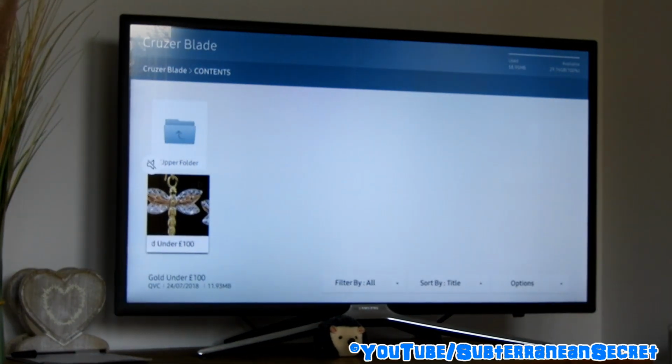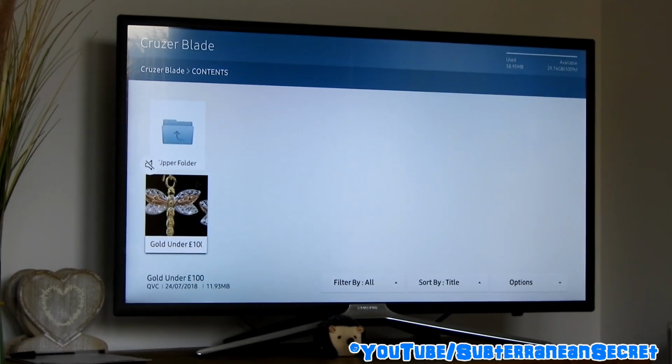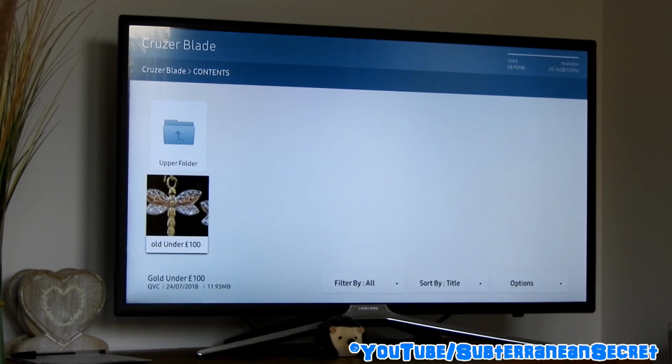So that's basically it. All you need is an external hard drive or a USB stick in some cases, but bear in mind it may not work. Simply plug it in, press the record button, it will then format and test the USB stick, and then you can just record all your favorite programs from your Samsung Smart Television, from live television, and then just enjoy them afterwards. So that's how you do it. Thanks for watching.